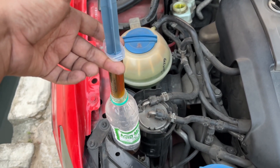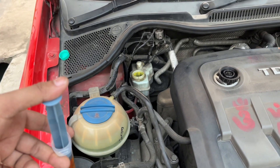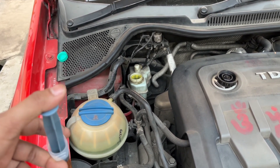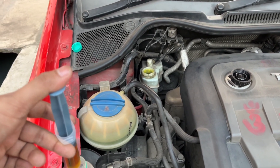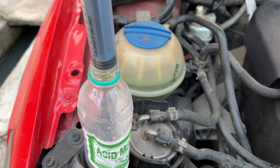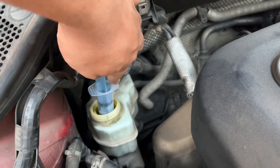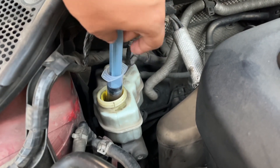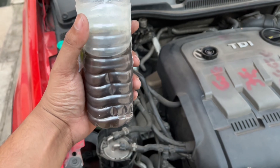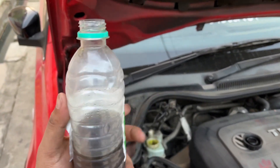This is the fourth syringe — I am just collecting the oil. My friend who has a VW said we need 250ml of oil, means brake oil, but with bleeding the full lines it's gonna take 500ml of brake oil. So this is the oil we had — approximately this is a 500ml bottle and I've taken out almost 250ml, so we'll be putting the new oil in now.